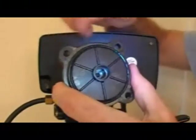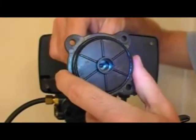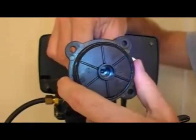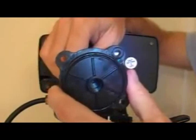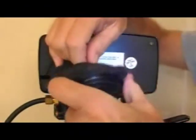That would mean it's OK. Now if you apply torque and you can't get that little white gear to spin, or it barely budges and instantly stops the second you stop applying torque, then the meter dome is probably bad, and that would explain why it wasn't counting down. You can replace it and be back in business.